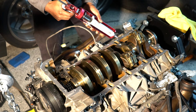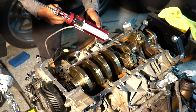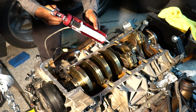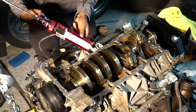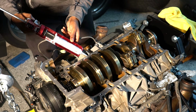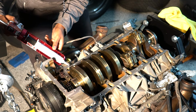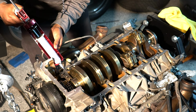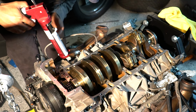I actually have a high tension, or at least high force caulking gun here. I think it was 9-10 ratio. I'll put it in the description below for about $10-15, and it does the job perfectly fine. You can see I actually use the black part of the Mercedes sealant, and I actually have that pushing down it with the caulking gun. So it does a really good job. It gets your sealant out nice and smoothly. Not heating this up would have made the 2mm bead nearly impossible, that's for sure.